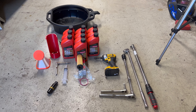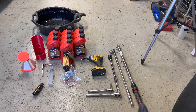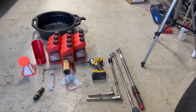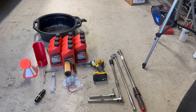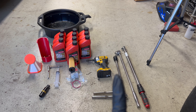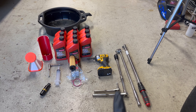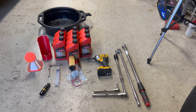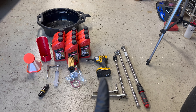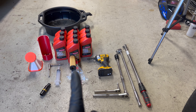Here are all the materials you're going to need. Starting over here, we've got a torque wrench set to 150 foot-pounds for re-torquing the wheels — that's for the 350, not 100% sure about the 500. A breaker bar to get the lug nuts off, or you could use an air impact. Here we have a ratchet with two extensions and a 27mm socket for taking the oil filter housing off, then a 3/8 ratchet with extension for the oil plug, and a small impact with a 21mm lug nut tool to run the lugs off quickly.